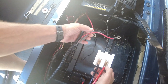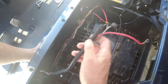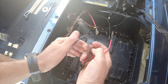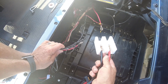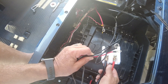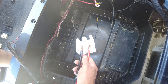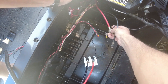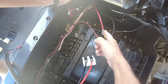When you have the lead acid batteries out, you're going to see that the charging port junction has a cable that normally would go to the lead acid batteries — a positive red, a negative black, and a temperature sensor. We're not going to use these to connect to the junction box. This is specifically for the EZGO RXV 48 volt, but it may apply to your cart as well. I've already tested and I don't require these cables to make the connection. I'm looking at the main DC positive cable for the golf cart and a couple of negative cables, and there's a similar place where I can mount the junction box. The only other cable I can't get to that location — I'll do a remote path and show you when the time comes.